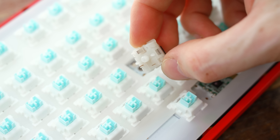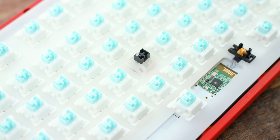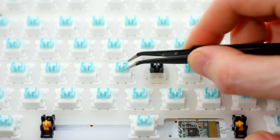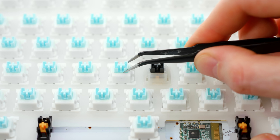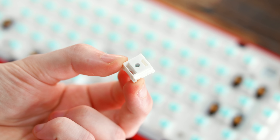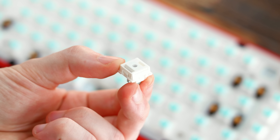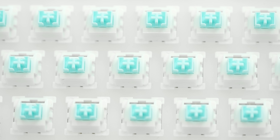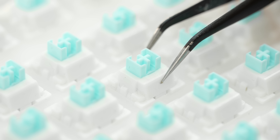You can also see a layer of foam sandwiched between the plate and PCB for added dampening. Even though we went with the Hall Effect config, the PCB still has hot swap sockets underneath — meaning you can also use MX style three or five pin switches alongside the Hall Effect switches. That's pretty interesting; I don't think I've ever seen that before. When I first got this and started using it, one of the first things I noticed was the amount of audible rattle. At first I thought it was the keycap stems, but it's actually the switches themselves — the Hall Effect Lynx standard switches definitely have some play and wiggle inside the plate.